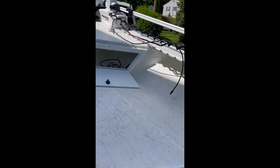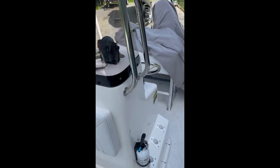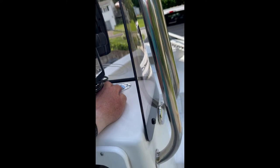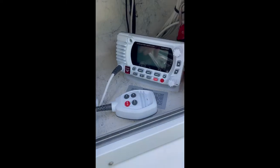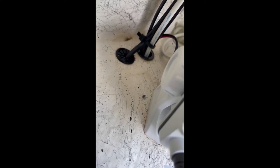I just got my lights today — we're going to replace the bow light and I'm going to mount those right now. I got my heading sensor mounted. I got my network cable run and had to redo the whole clamshell again because the network wire got added to it. I ended up having to drill another hole back there for the network wire because I couldn't fit it through with all the other wires. I drilled that hole, siliconed all the edges of the wood core, put in a nice little trim ring, and brought my wire down to the next level.